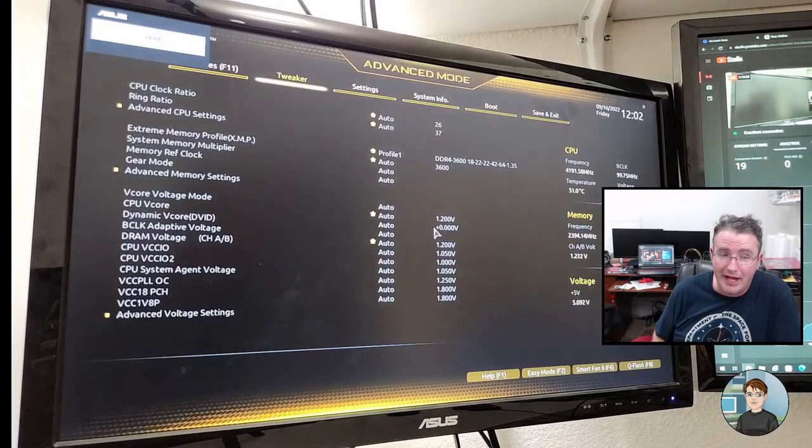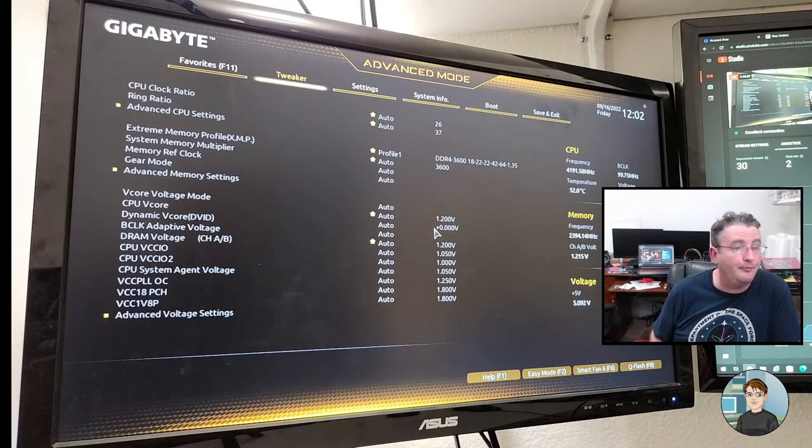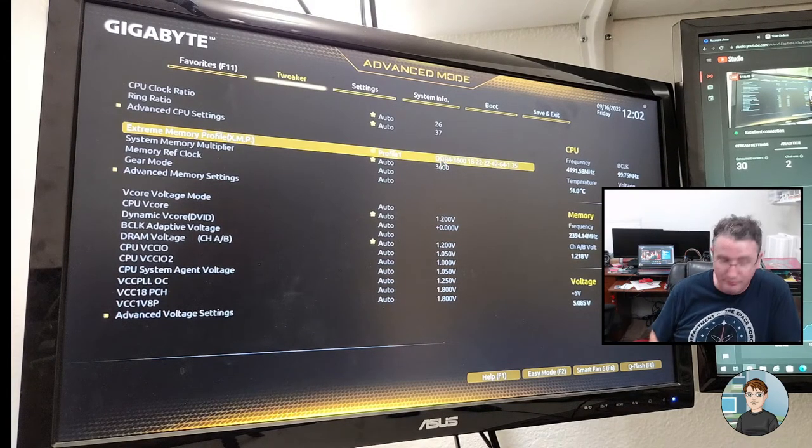And there's something else. You know, this was brought to me for a graphics card upgrade and a RAM upgrade. I didn't check the system before I took it apart, and I mean I made sure it booted up, but I didn't run a stress test on it. I didn't have the PIN number at the point, but it's possible the blue screening was happening to begin with, and the end user thought, oh, I just need a better graphics card and more RAM, and then the blue screening will stop, which it doesn't work that way. So that's another possibility. That's something I could ask the end user, who's a kid, so I would ask his dad, and his dad would ask him through his cell phone at school, and maybe we get an answer.